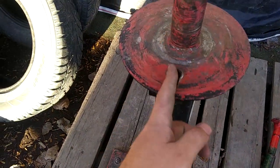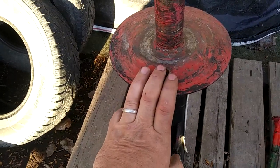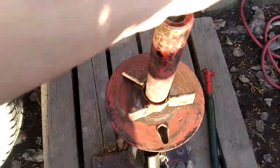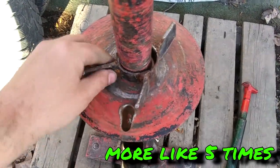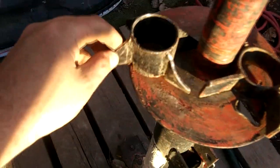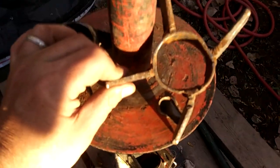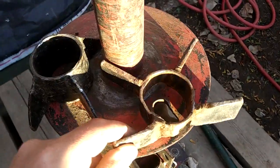Recently there's a little metal pin — there's a handle right here that comes on it and it breaks off. I had this thing for 10 years, nine and a half years before this broke, so this may not be a problem. I've just used the heck out of it. And finally this little guy — this thing is supposed to hold your rim down. I've welded this back together probably 30 times. It's kind of a piece of crap. I made another one — it works for some mag wheels. I made it all out of similar thickness metal. The original used thin pipe but these thicker pieces are like 3/16ths or something. So that's something you might want to remake.